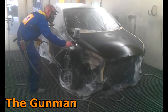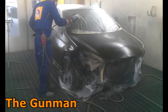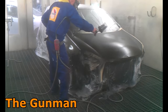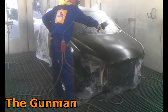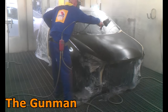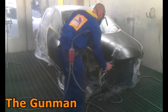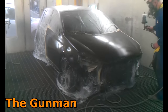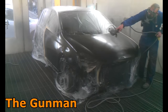I would go into that spray booth and never leave until I was finished. Little things like using the PPS cups — something a lot of my followers wouldn't be used to seeing me use. I'd mix all my paints up, set the booth to 27 degrees, go in and paint. I was like clockwork — I had gun settings, a whole system I would follow, and I was getting paid really good coin while producing a really good amount of work to a top quality.